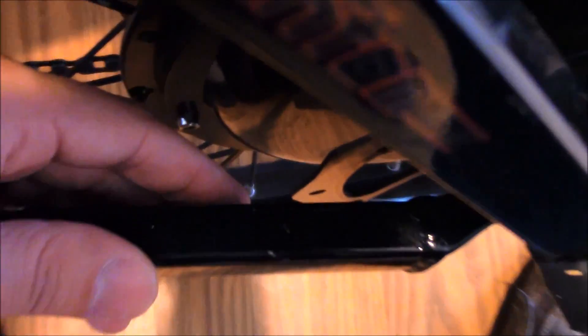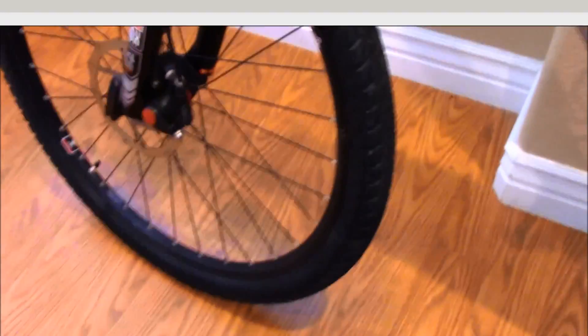It's already cutting pretty close to the bar here, so 180mm might just barely fit in the back — I'll have to see. A 203mm would bring it out further and might be too close. I also upgraded my tires to these flat jacket style road tires. You can pump them up to 65 psi and rolling resistance is a lot less, so you gain speed a lot quicker — not that I need more speed with an 84 volt peak setup, but it works.